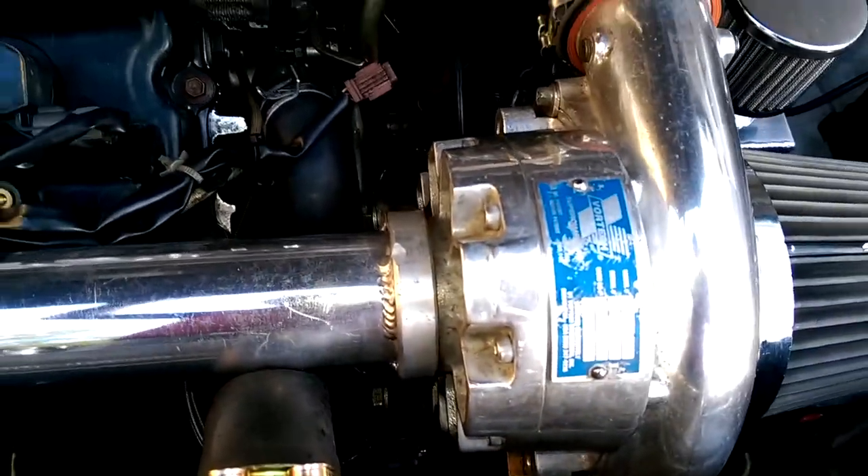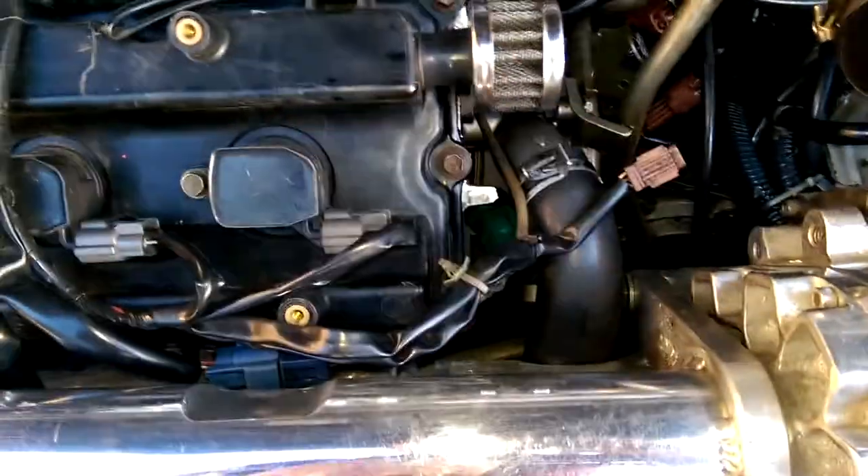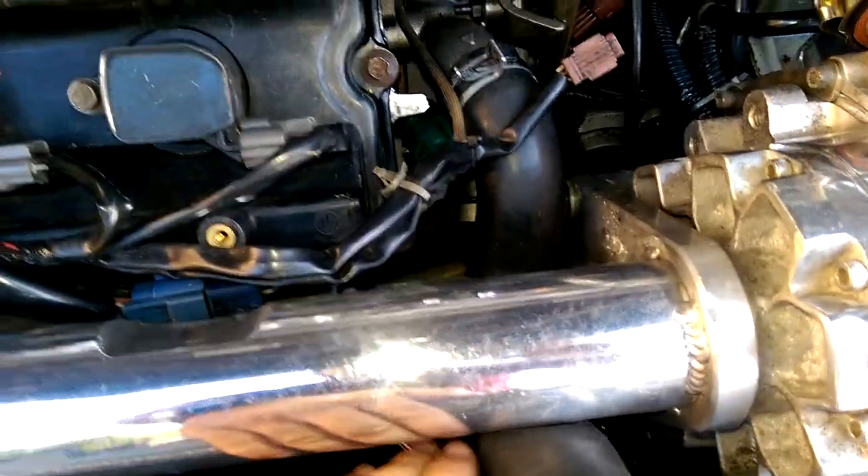You can see the plate — that's where the supercharger bolts up. I kept my water heat; I didn't want to eliminate that. You can see it's still there, going right through the piping of the water heat, and it holds up on the header with all six bolts. I wanted to keep everything underneath, just for looks, so I kept the holes underneath the supercharger.